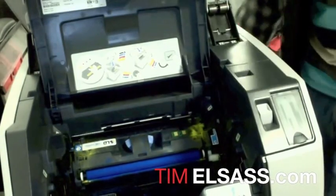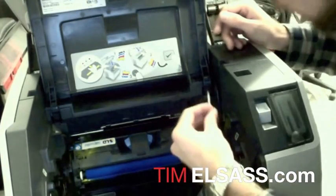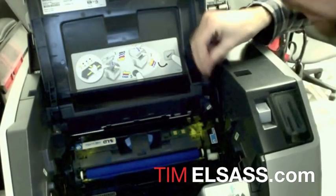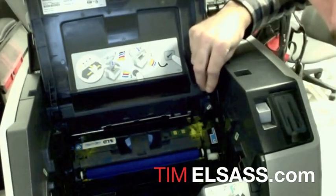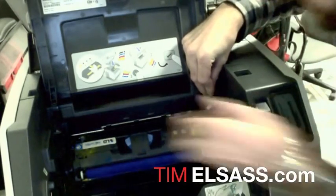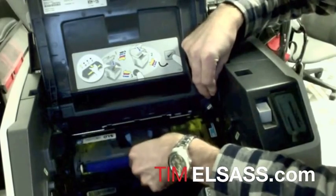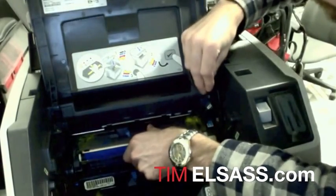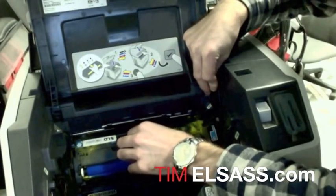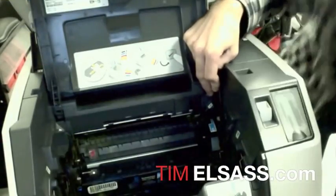The next step is the ink cartridges. A little tip here — right above where this blue arrow is, you'll see there's a hole and you'll see a piece of white plastic in there. Just take a screwdriver or the tip of an air canister, feel around in there until it loosens up. Without the screwdriver in there, it's locked in place — that's how you easily remove these cartridges. Then line up the two blue arrows, squeeze the center cartridge, and remove each one out individually.